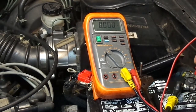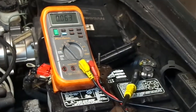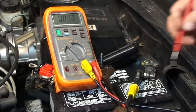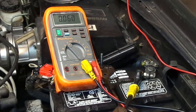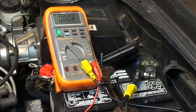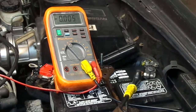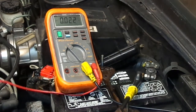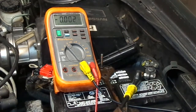There's the connection from the nut to the post — that's a good connection from here to here. Let's try it right here — we're good. Try it on a frame piece. There's a body piece at 0.06. Since I'm doing computer diagnostics, I want to check if there's an issue with a computer ground. It's on the intake over here. That's one ground for the computer, and there's the other ground to the computer. Alright, we're good there. The grounds are good as well.